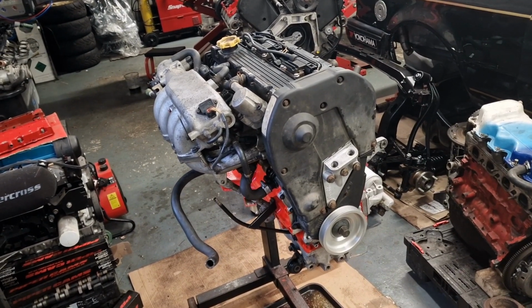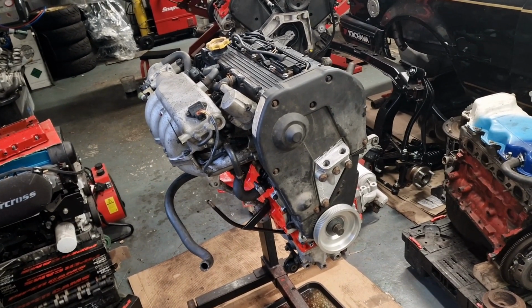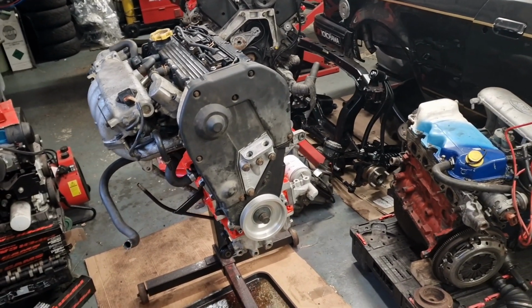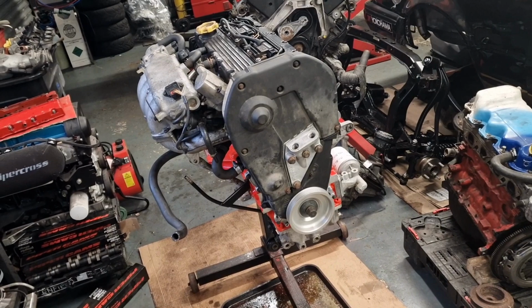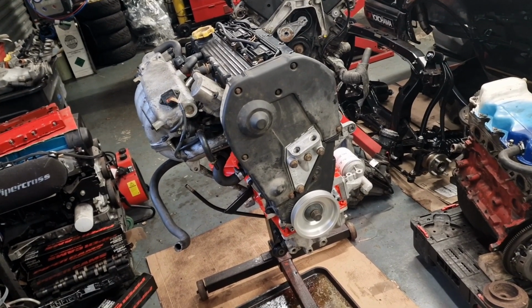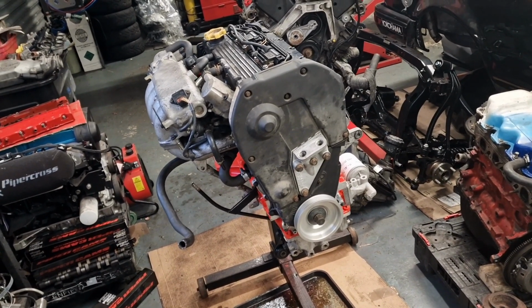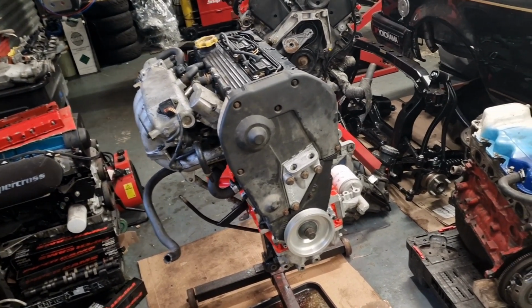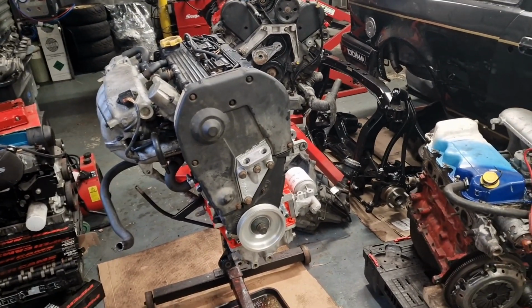It's unwrapping all the wiring harness, making sure you don't get anything muddled up, so you need to lay it all on the floor, and then literally pick out the plugs like the horn or the washer bottle plugs, and then pull them all out of the wiring harness all the way up to the fuse box, etc, etc.